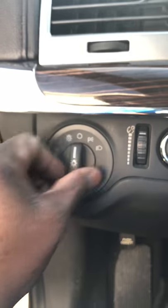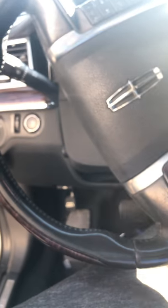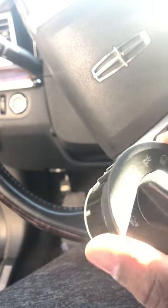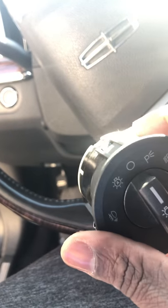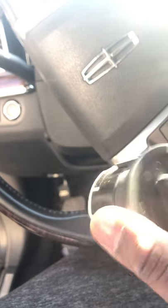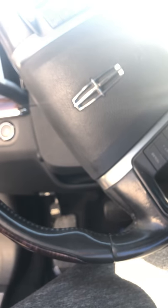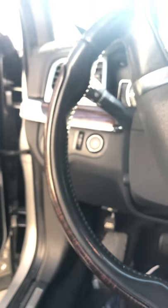And that's it — my lights are back working perfect. The reason my switch messed up is because I have a sound system in my vehicle and I think the vibration from the bass rattled a little part on the inside of the old one. I got the part at AutoZone, it was like $70 — O'Reilly didn't have it, Advance didn't have it. I checked my lights up front and they're working perfectly fine. Thanks for watching.